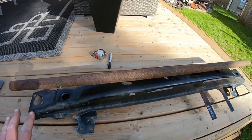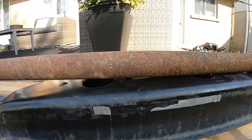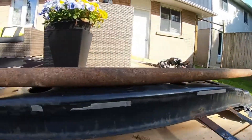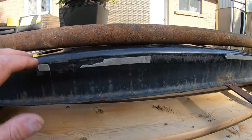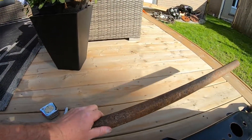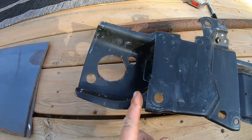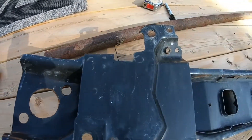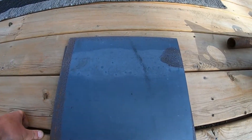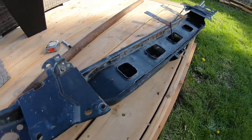This will come out something similar to what I'm showing, which will eliminate all that space. The tricky thing is getting everything lined up with the plates to maximize room behind the skin. I'm going to try to find a happy medium so I know how much I have to cut. I'll probably cut the ends of the bumper off, trace this whole section onto my plate, then do all the holes needed. It's going to be a pain - a lot of drilling, a lot of grinding - but let's get going.